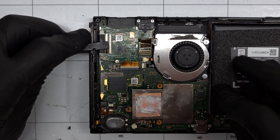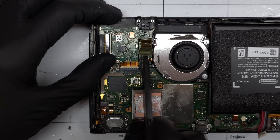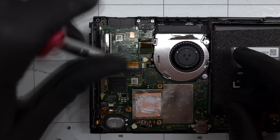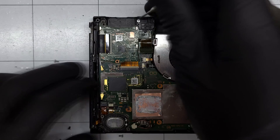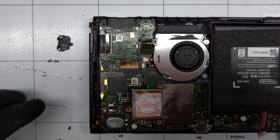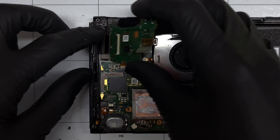Back up to the game card reader, we've got one large ZIF connector holding down a ribbon cable. I'll unlatch it and then disconnect the lego-style one to the right. Now three Phillips screws stand between this card reader and freedom. Two hold in a plastic support over the headphone jack, a commonly abused port. With the board disconnected I'll slowly lift it up straight so as not to twist the ribbon connector on the left — it should safely slide out.